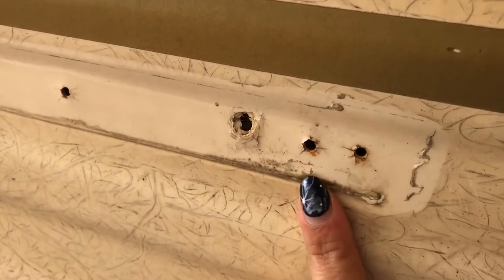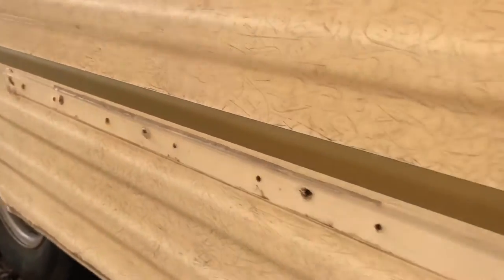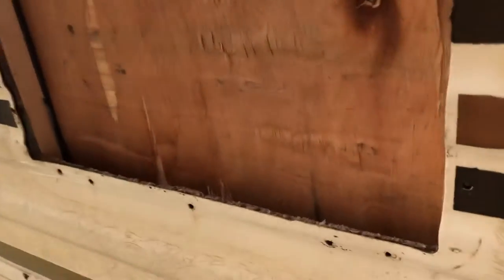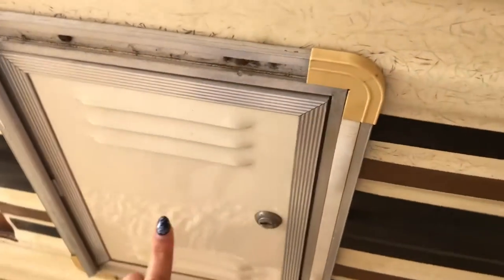It's almost there, so now it's my job to clean up all of that junk so that we can get that piece of trim attached properly, because otherwise we won't be able to seal it. I've already cleaned all around this section — that's where the propane tank goes — and I've already cleaned around this one as well, that's where the hot water heater will go back into. I've learned over the years it's super important to get the edging really really clean, because otherwise you can't get anything to seal and it'll still leak, so because of that we're going to reseal this one as well.